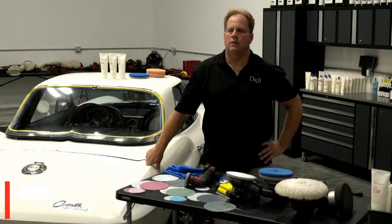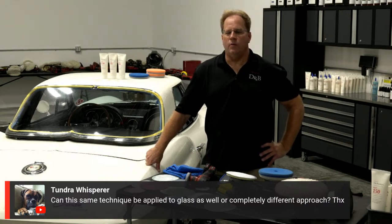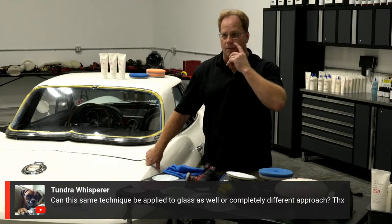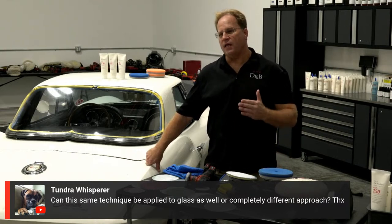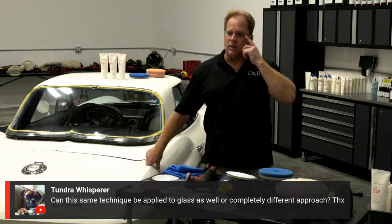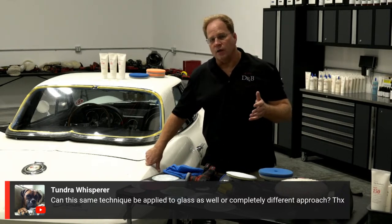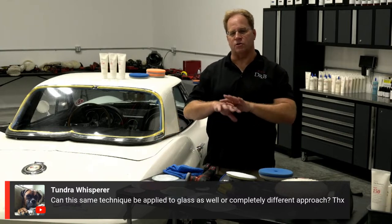Okay, here's a good question. Tundra Whisperer. This guy always comes in with some really good questions. Can the same technique be applied to glass as well, or a completely different approach? Well, and we've covered that in a live broadcast. It's the same process, but different types of sanding discs and different tools. For glass sanding, you're going to be using a rotary polisher. I know that can sound like grinding, but you got to have an interface pad so you got some cushion there.